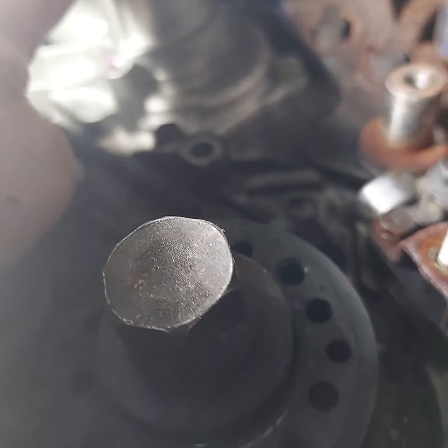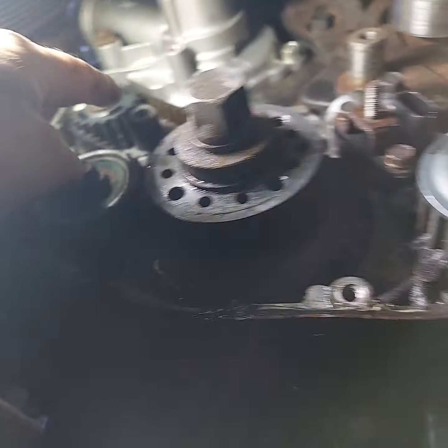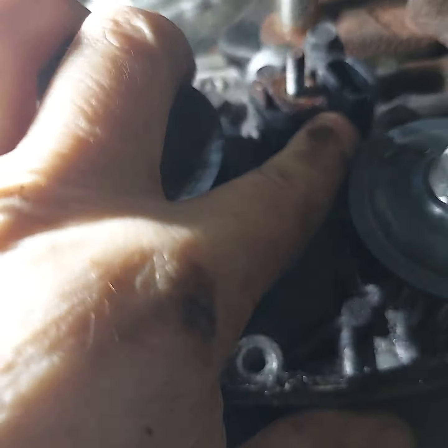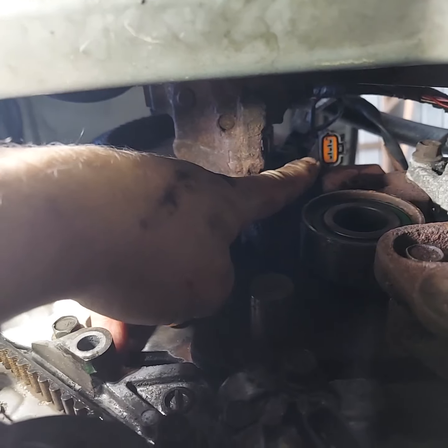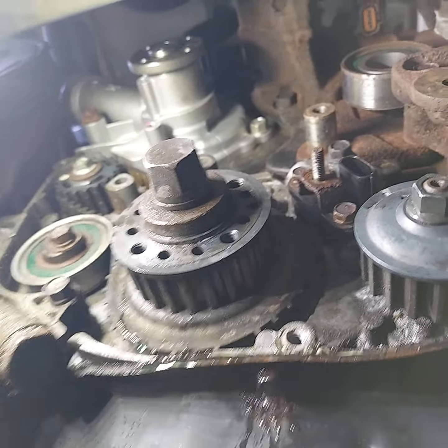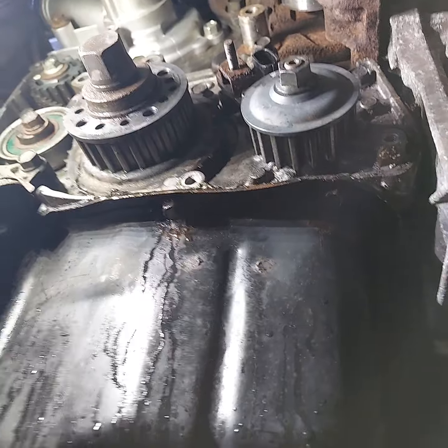Got all five bolts tightened down on the water pump. After a refresher: this is the balance shaft and this is the oil pump, so this belt here is the balance shaft belt — I was thinking there wouldn't be enough room for a balance shaft there. Anyway, the crankshaft sensor is in and tightened down. Before I took all this apart I put the cover back on and started it up to confirm that fixed it. You can see the connector up there for the crankshaft sensor where it goes into the cover and follows the harness down. We'll get all that put together in a different video. Appreciate you watching — share, like, subscribe, comment if you will. Have a good day.